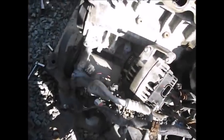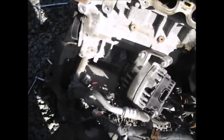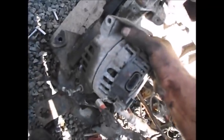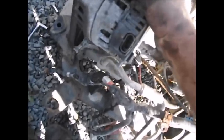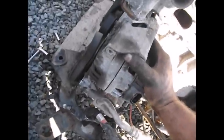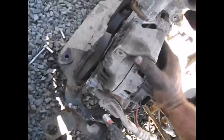There's your alternator — it's a little bit stuck on the belt because it hasn't been spun in a while. To replace the alternator it's the same exact steps but in reverse. You put the alternator back in place on an angle to start, lining up the pulley, tip it in at an angle, and then bolt it back in place. There could be some force involved, but you overcome that.